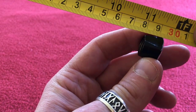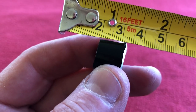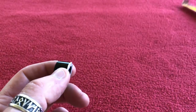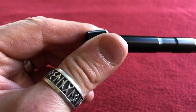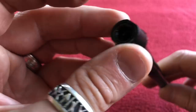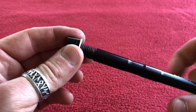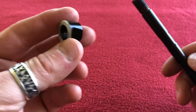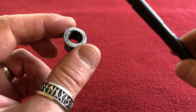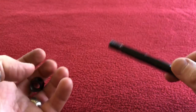Onto the nut itself — this is a Yoleo nut and it's a little bit shorter than when we last looked at it. I have filed this down — I took about two millimetres off of this nut, so it should be 12mm and it is. The reason for that is now when I screw it in through the bike, it sits flat, it sits flush at the end of the length of the through axle. I can't lengthen the through axle — 172mm was the longest one I could find with a 1.5 pitch thread. I already had the nut so I wasn't going to spend extra money on another one. I've got at least 12mm of thread to hold my back wheel on.